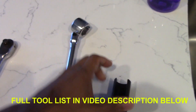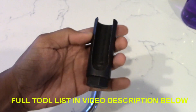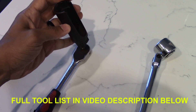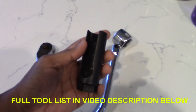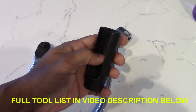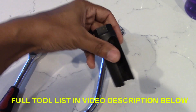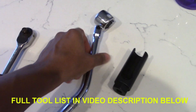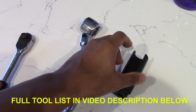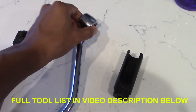They do sell an alternative tool right here — another O2 sensor removal tool. This one installs right onto a socket wrench like so, and it has the same kind of deal where the wire fits right in here and then the socket sits right on the O2 sensor. I personally prefer this tool just because it gives you a little more clearance and has a shorter base. This other one's pretty long, so unless you need the reach, you're probably better off with the shorter tool.